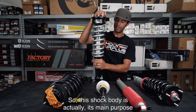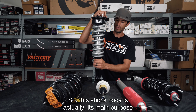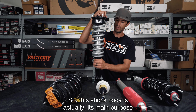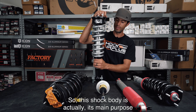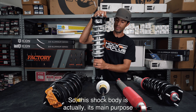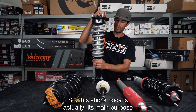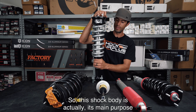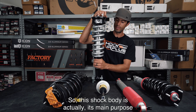Here we have just a normal, straight, typical shock absorber. It mounts on the frame here and here, dampening that energy up and down in a traditional manner — this is what everyone's kind of used to. Some people will call a quick strut a full coilover. That's okay. Technically it is a coilover shock, so the coil is over the main body of the shock and it's resting on the shock through the coil spring collar.